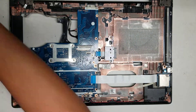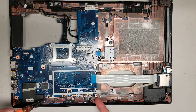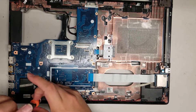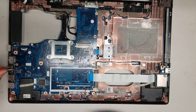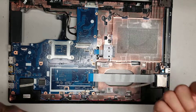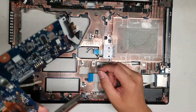Let's remove the motherboard. There's one screw up here. Hopefully you can see all the screws I'm going to be removing — you don't have to remove those two screws. There's one screw down here and one screw over here. I believe that's all the screws holding the board in place, because the rest were held in place from the other side.